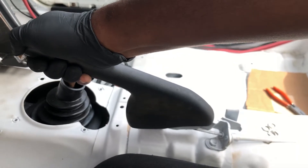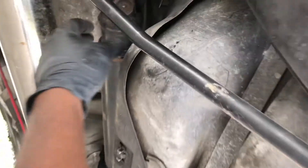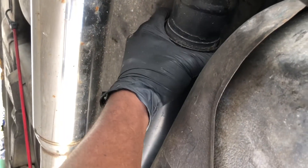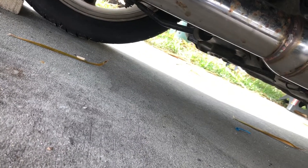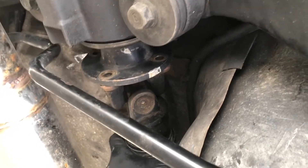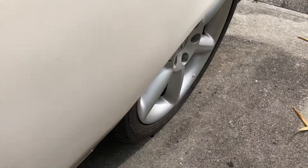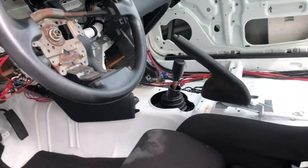This is so sketchy - it's not even on a jack stand, the jack is just there in case the jack fails. The driveshaft is not easy to spin. The reason this doesn't work is because the driveshaft is connected to the diff, which connects to the axles and then to the wheels - so if the wheel's on the ground it's not gonna spin, aka driveshaft can't spin. Fail on my part.